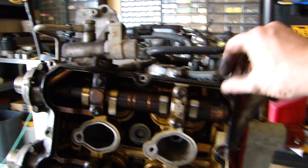So we have our valve cover off. You'll notice there's a gasket here — you're definitely going to need to replace that. This one was probably shot anyway. It's definitely suggested you have a drip pan or something, because even though you've drained the oil, oil will just come out of this regardless.